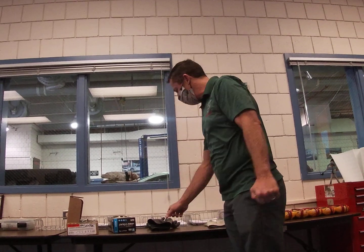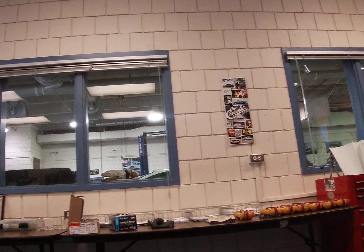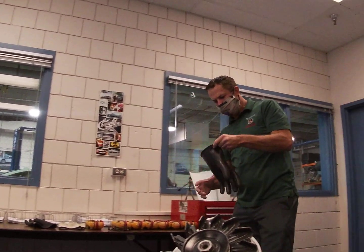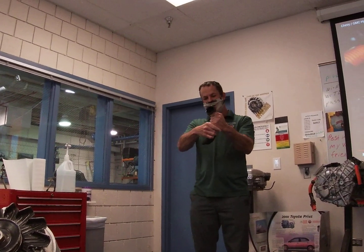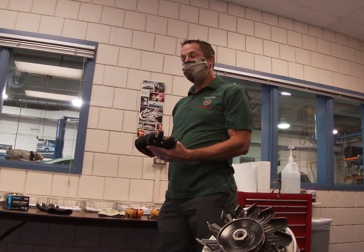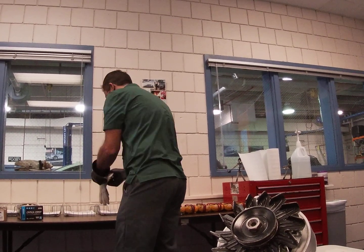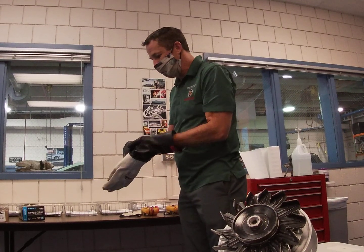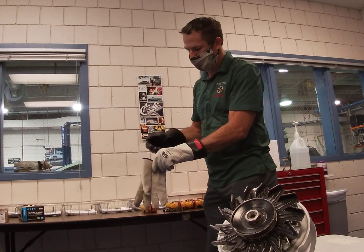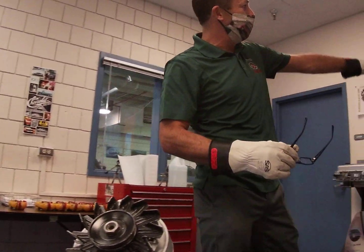So how do you test a glove? I test a glove any time I put it on. I'll blow a little bit of air in — today with my mask on that's going to be tough, so I'm just going to twist this up a little bit and make sure it holds. And it does. I tested these earlier this morning too. I'm going to test this glove in the same fashion — twist that up just a tiny bit. There's a hole there — actually it does hold. So we don't have any pinhole leaks in these. The problem is we're going to be working with hand tools, and this rubber could easily become torn. So we do need the proper fitting leather gloves to protect the rubber glove from getting torn. Now that we have the right gloves on, it's time to get to work. We're going to find that orange plug and test it, and make sure we have isolated the battery properly.